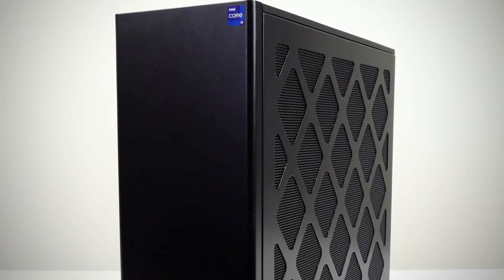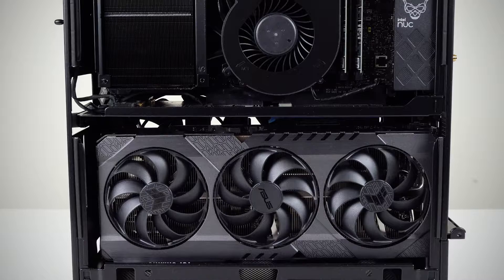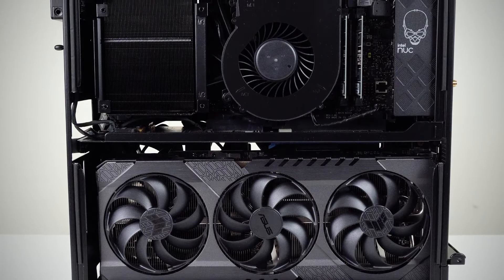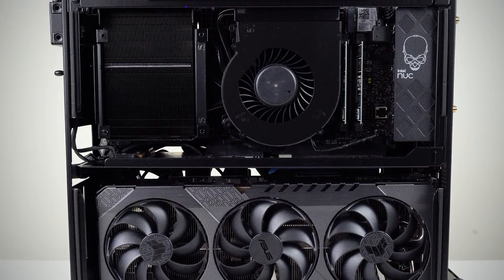It now just looks like one of those boxes from Dell or Compaq you used to put the monitor on top of. This review unit came fully pre-built, featuring the i9-13900K, an ASUS TUF RTX 3080 Ti, 32GB of DDR5-4800 memory, and 1TB storage. But all NUC13 Extreme retail kits will be bare bones, so you'll have to bring your own GPU, RAM, storage, and OS.